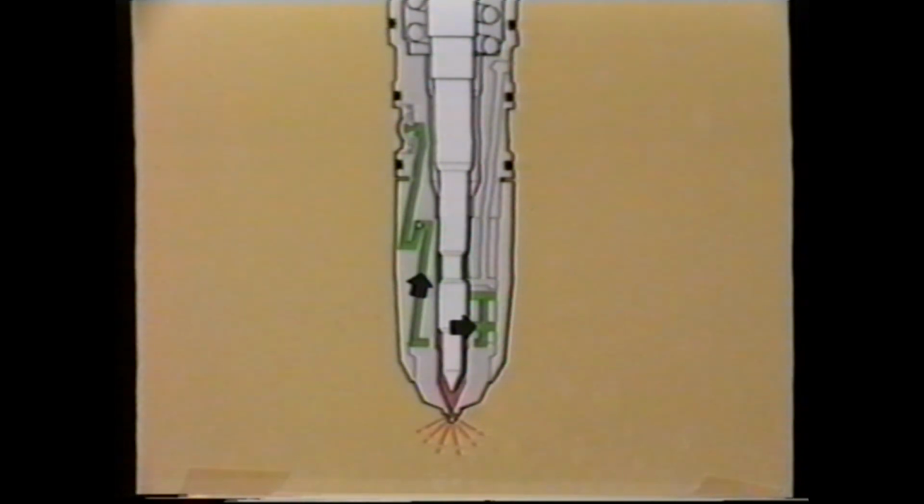The check valve drops onto its seat as this pressure builds up, isolating the feedback to the supply rail. If the valve fails, fuel under pressure is fed to the remaining injectors and allows the engine to run until all the fuel is consumed within the faulty injector.